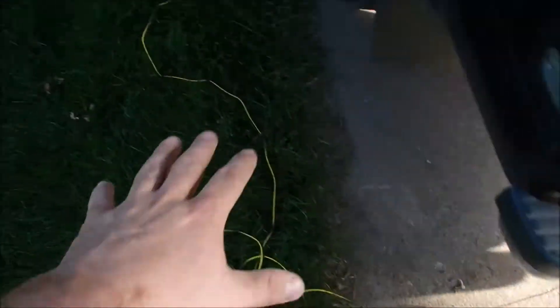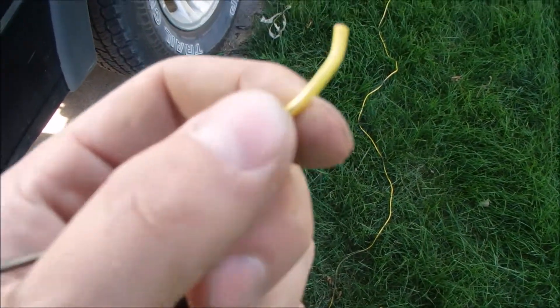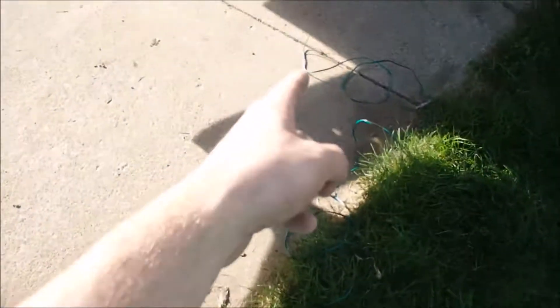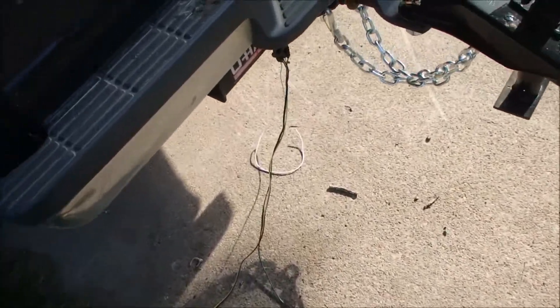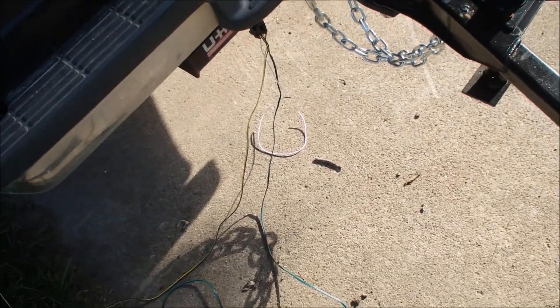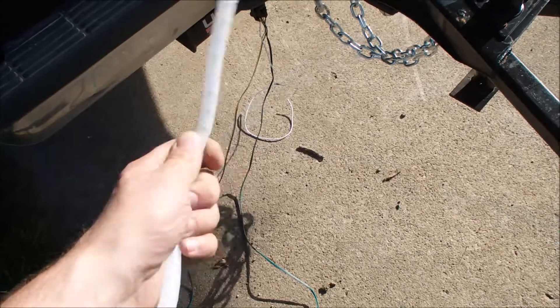What I did was I just took them out, untangled them, and took them in through the window of the truck. I took my meter to them to make sure I was getting it right, using the brake and blinkers and everything. Yellow is the left blinker or stop. The brown one is a running light. Green is the right side brake or turn, and the brown with that is also a running light. The white one is just your chassis ground - that just gets screwed to the trailer. Now this spiral wrapping around my neck - a lot of people will just electric tape their wires, but I kind of advise against that because if something goes wrong you've got to take off yards and yards of tape to fix it.